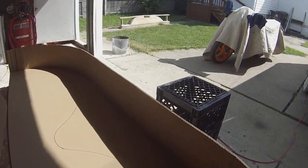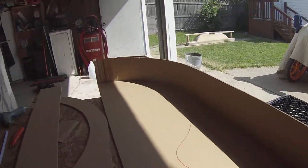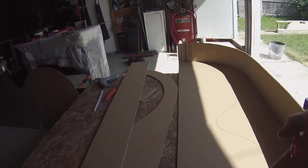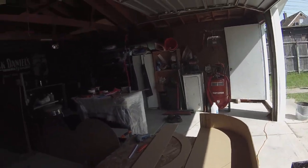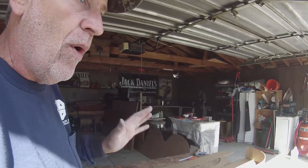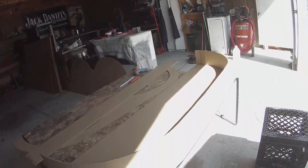The reason we leave this big long base here — as you can see, when you start getting the hot glue on here it's already moving a little bit. We'll put one big piece through here to hold it straight, but it doesn't really matter because it's fiberglass. When we bolt or screw this thing down to the side of the trailer it'll pull itself in — it's gonna be so thick and strong it won't move.